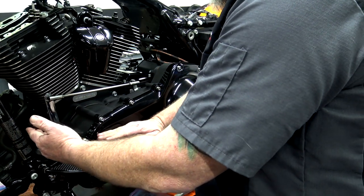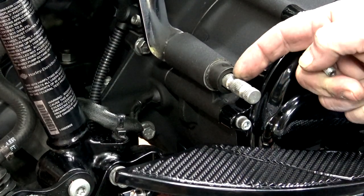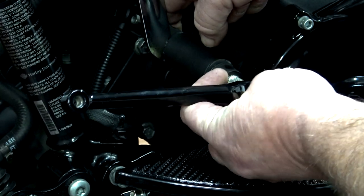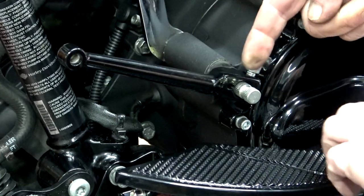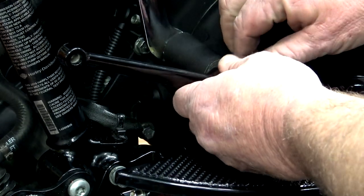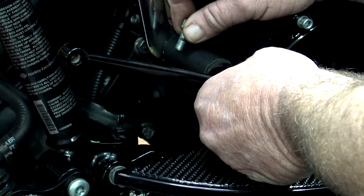If you have the heel shifter, make sure it's not hitting your board when you're going down. Right inside the shaft there are two grooves — that's where these bolts are going to go, laying in there just like that. When you put the bolt through the shift lever, put it on at the angle you want it at, and you want that bolt to run right down the edge of that groove. If you catch the teeth over here or out here, you're going to end up mangling the whole thing. Make sure before you put the bolt in, you look down in there, get it lined up on that groove, and then run your bolt in.